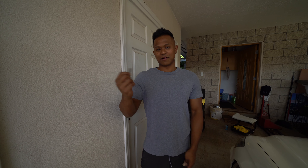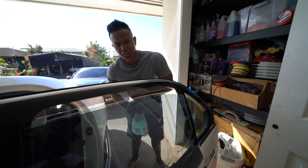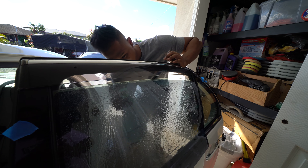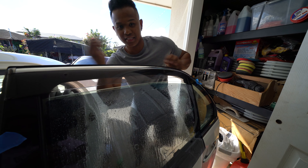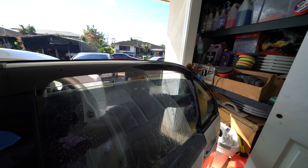Here's an important tip: when you're cutting the blade on the windows, you're gonna wanna make sure your blade is sharp, or else you're gonna cut into the glass if it's dull. We gotta prep the inside of the window now — spray it down with soap water and then clean it off. You gotta make sure there's no dirt or anything cause you're gonna see it in the film if you apply the film after. Just shoot the window down and take your blade and go across it and clean it off.